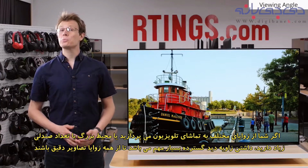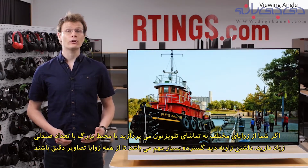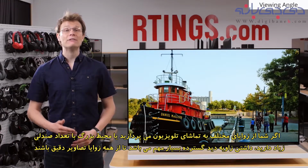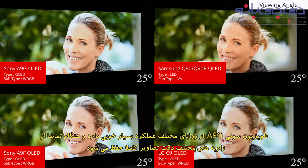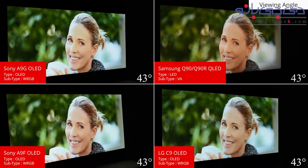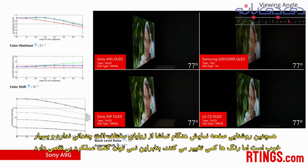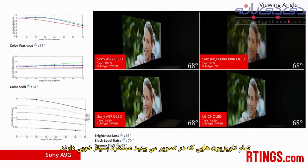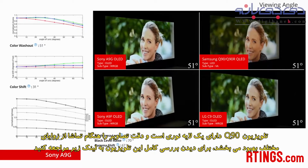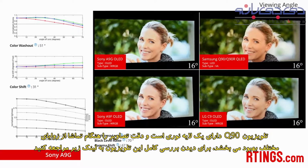Now, if you sometimes watch off-axis or have wide seating, then good viewing angles are important to ensure an accurate image from any viewing position. The A9G offers excellent performance as the gamma remains very consistent. The brightness also doesn't drop much, which is good, but the colors do shift, so it's far from perfect. All of these TVs perform well, as can be seen in the video. The Q90R has an optical layer to improve viewing angles, so check out our review videos linked below if you'd like to learn more.